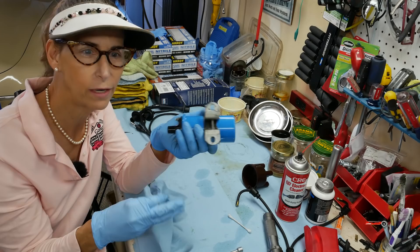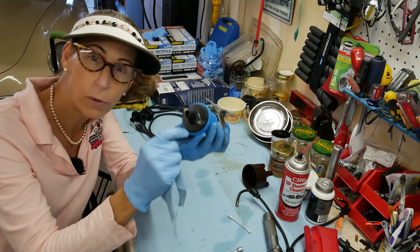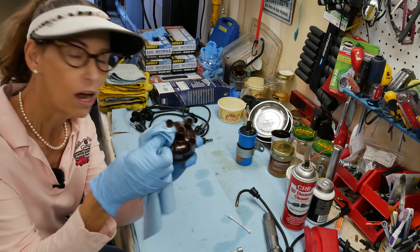When you're inspecting your coil, these things are filled with a dielectric — like a really thick oil, goopy inside. It'll be pretty obvious if they're leaking, and if they are your coil is definitely shot. Just do a quick inspection looking for any goop around the edges coming out here. This one looks fine. We'll call that good for the coil and set it aside. Why not start on the distributor cap while we're at it.